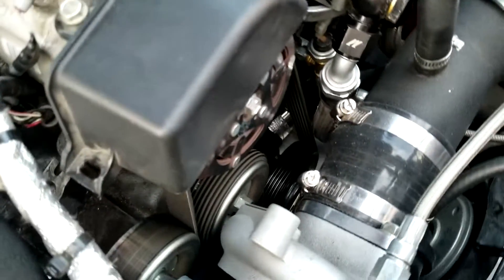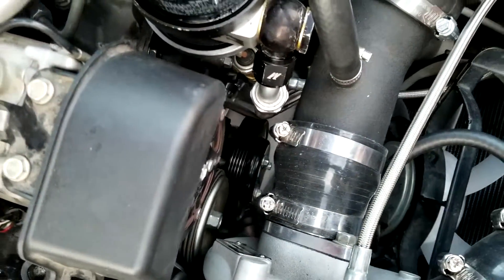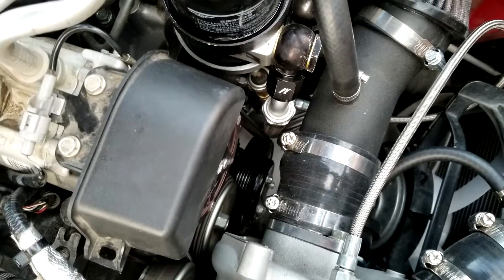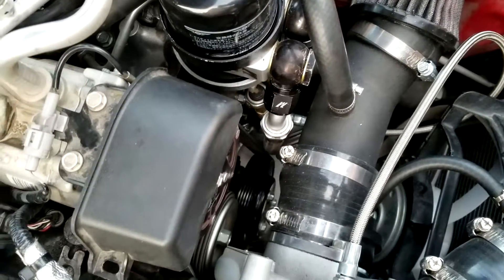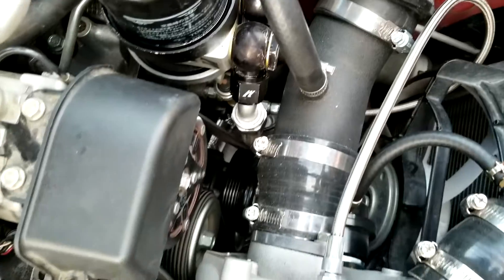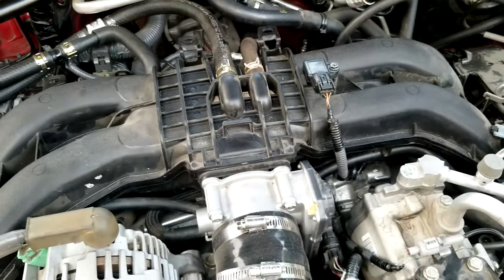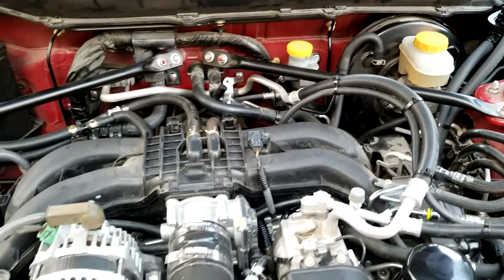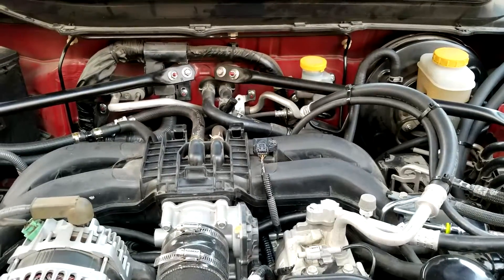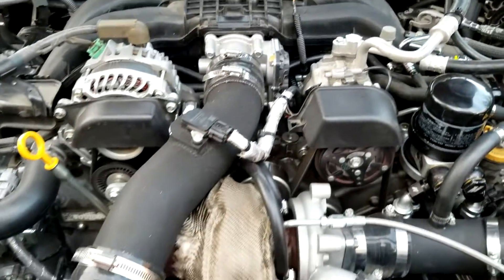Be careful with your oil feed right here — make sure you use a proper seal. If you're not using Teflon tape, use Permatex thread seal like I did, because a lot of people get leaks there from improper sealing or tightening. Also, underneath the intake manifold there are hoses that need to be clamped, because they can blow off due to increased pressure from the turbo. I have a video coming on that as well.